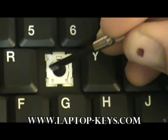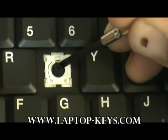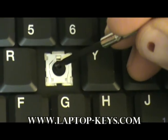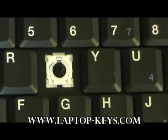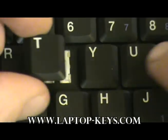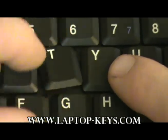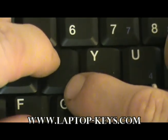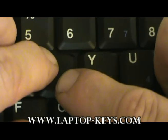Now, if your rubber cup is missing from your keyboard, we have provided a replacement. At this time, you may put the rubber cup in the center of the clip. Now take the keycap, center it with equal spacing between the rest of the keys, then push down on diagonal corners and the key should snap into place.